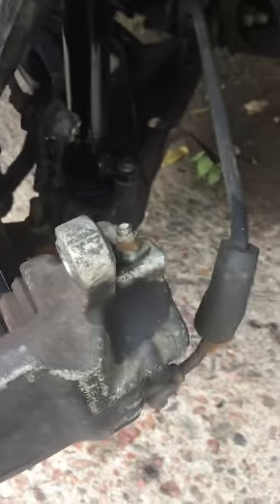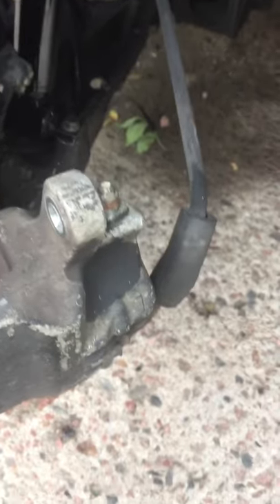I'm still changing these brakes — went and got the caliper pusher on the 03 CTS. The top nut is 17 millimeter and you only need to take one off. I got my new ones up in there, I just need to push these back. Let me take this out of the casing and I'll be right back.